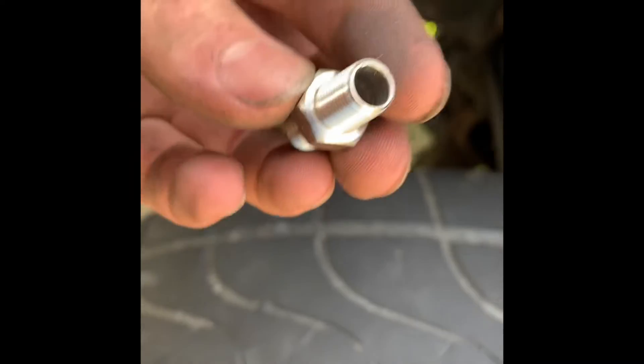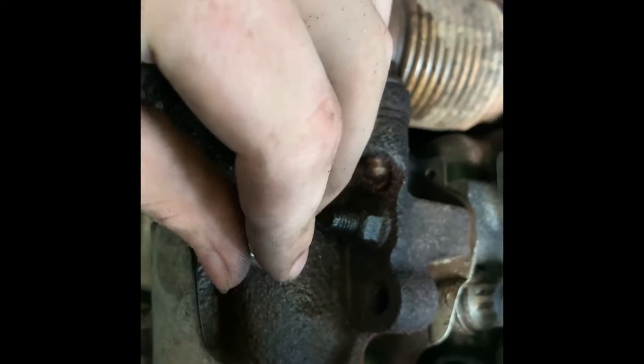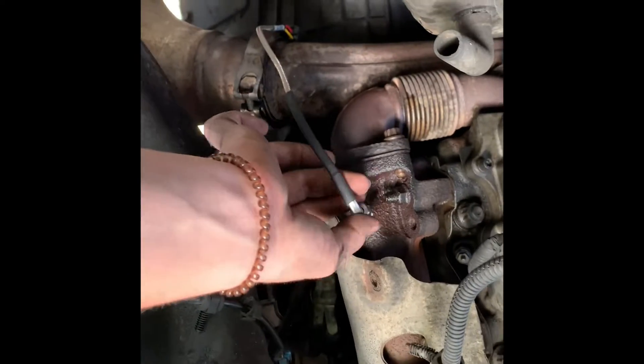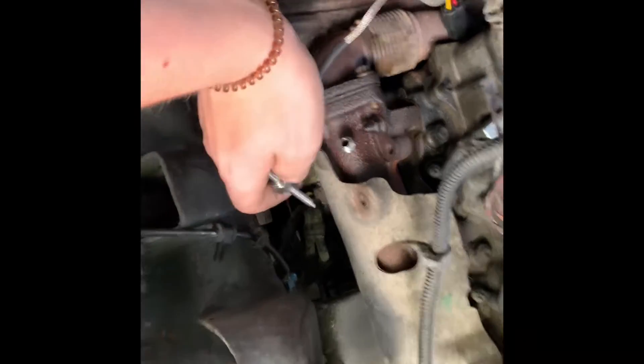So the way this is going to work — it would be a whole lot easier if I had some kind of body mount so I could use two hands. After I got it tapped, I went back with the magnet one more time. Now we're going to take the sensor and get it started in there — oh yeah, just like a warm knife through butter. Then we take our ratchet, tighten that up in there, take our probe, stick it in there, tighten the nut up, position it how we want it — probably up like this — tighten it down, and we'll have the gauge installed.